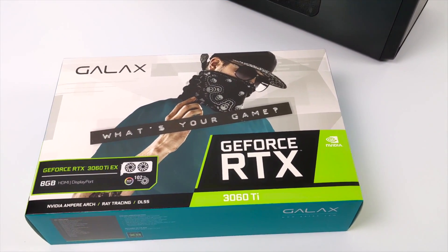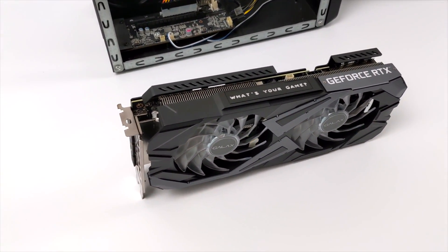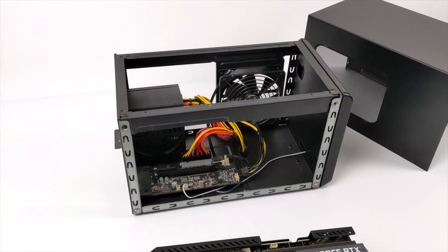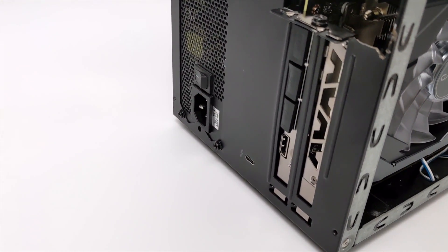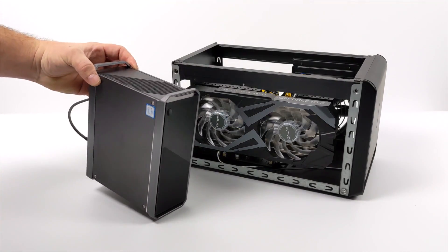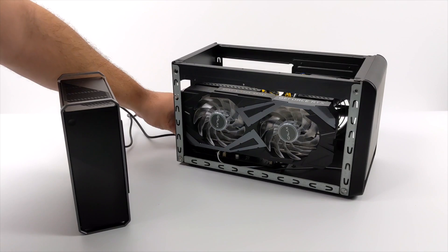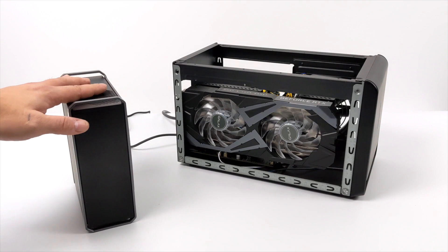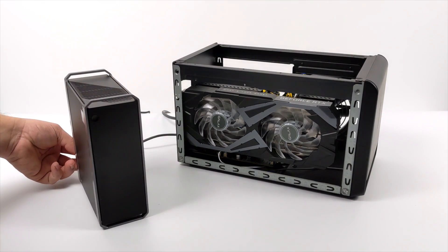I was lucky enough to get my hands on a brand new Galax RTX 3060 Ti. I'll have a full review of this card coming up very soon on a more beefy build, but since I had it in my possession I figured we'd test it externally with the Core Box Pro. I just need to drop it inside of this Sonnet Thunderbolt 3 external GPU enclosure, which has a 350 watt power supply — it should be plenty for this RTX 3060 Ti. I have the Galax RTX 3060 Ti installed in this Sonnet enclosure, and when connected, in order to use this external GPU I'll have to run HDMI out from the Galax card to my monitor.